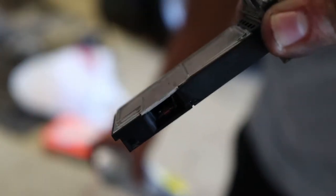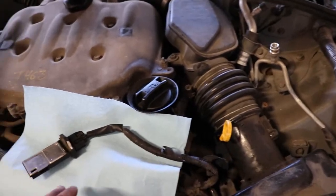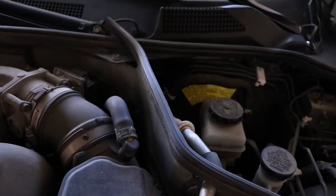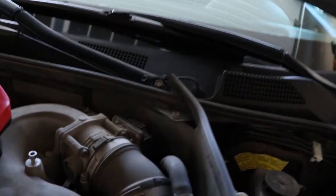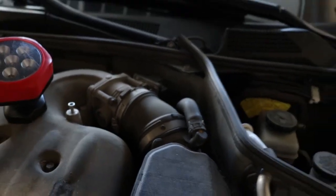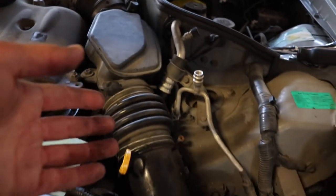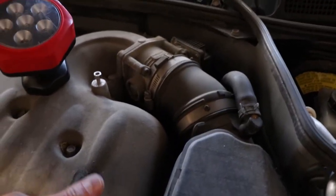Now that the MAF sensor is done, put it aside — maybe put a shop towel under it so it doesn't get dirty and the crucial bits aren't exposed. Now we're gonna remove the rest of the intake. There are a couple of different screws located on my car — yours is obviously going to be quite a bit different, but you're just gonna have to do some digging and see where those screws are and unbolt everything as necessary. You might see some clamps too — undo them. Also don't forget you might see a couple of vacuum hoses going to your airbox — you can go ahead and unplug those because when you assemble everything back together it'll be as if nothing ever happened.